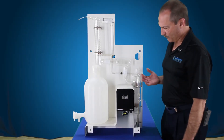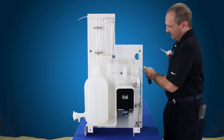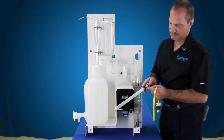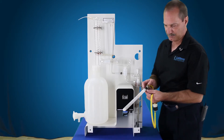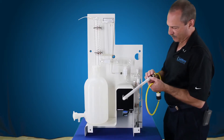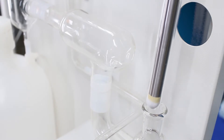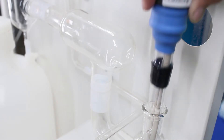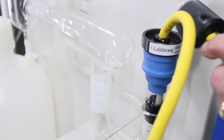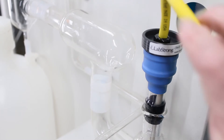Now that we have the old element removed, we're going to install the new element. Just simply take the new element. The element will come with the cord, the connector, and there's a cork on here — it's a cork-looking piece. It's a silicone plug that actually sits down inside the boiler to give you the proper height and location. So you just simply slide that down into the boiler. Then that stopper, you just push down in there. Make sure it's nice and tight. Make sure the element's straight. And that inserts it into the boiler.